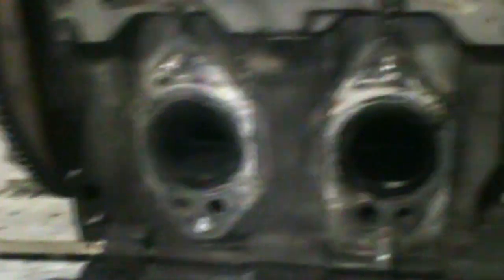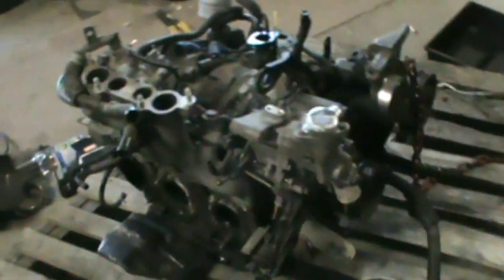I'll get one of the good side here — you can see the solid seal, and it has a bit of spring to it. They're pretty worn down too. Feeling around inside on the bad housing, it's all gouged from the seal going around. But this one feels pretty smooth, so hopefully it's in decent shape and I'll just have to replace the one front housing and rotor. I'll get the intake manifold taken off and then move on to the other side.